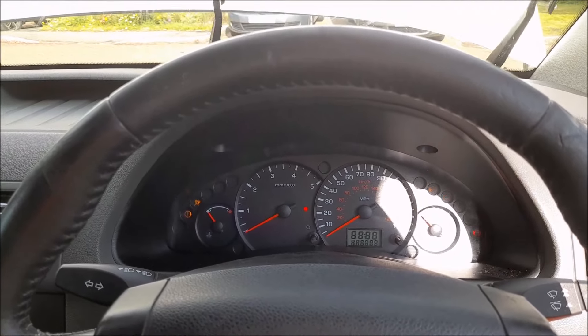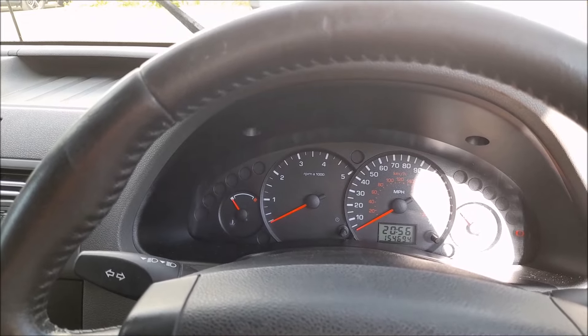We'll start it again. Now she's running fine. Because it's a warm morning, and that's the third time I've tried to start it. She'll run fine now, all day. Absolutely brilliant, but on a cold morning, that happens about between five and ten times every cold morning. Not that I've tried to start it many cold mornings, just a few. But when I picked it up, it did this as well, so hence the price that I picked it up at. So I've done some homework and I've kind of found out - I think it's the fuel pressure switch. I bought one, and I have the switch, so I'm going to fit it.